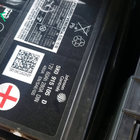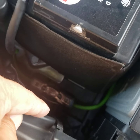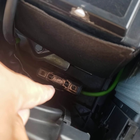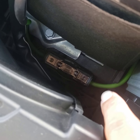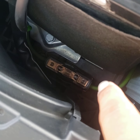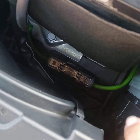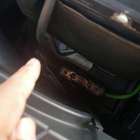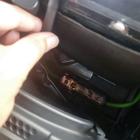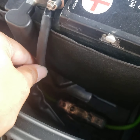Then ran the wire around the battery and around the back, because it goes in right down there through the firewall. You just poke it through with a coat hanger and some tape, push it through, pull it up, grab it, pull it around. There's my fuse — I screwed it down onto the plastic base of the battery station so it's nice and secure. One wire comes in here, one wire goes up there. I wrapped it with some black silicone shrink wrap, just the top few inches, right to the power. When you stand back you can't even see it.